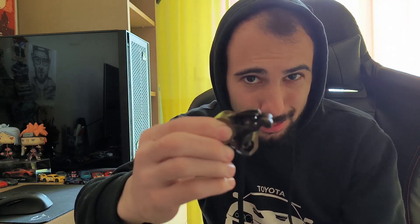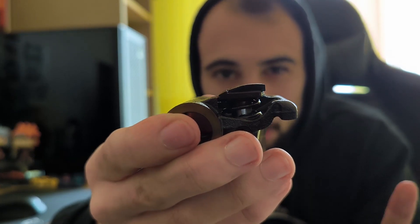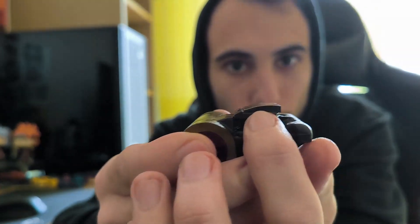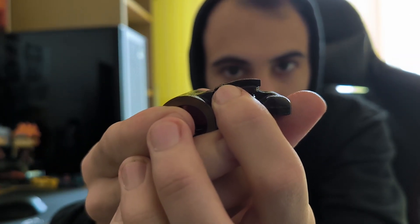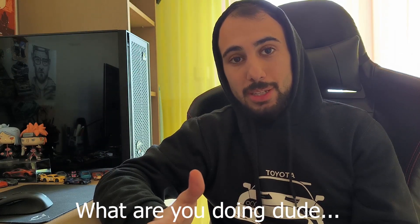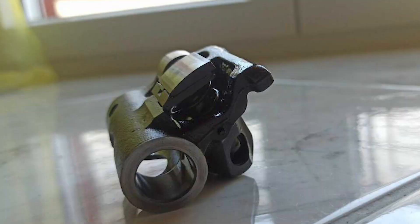This rocker arm is wiped, but not severely — so you might not even see it. There is a small wipe here, like it's been grinding against something, but it's so little it might look completely fine to you. I have a picture to show you — that's a great, completely healthy rocker arm, and that's the one I've installed in my car currently.